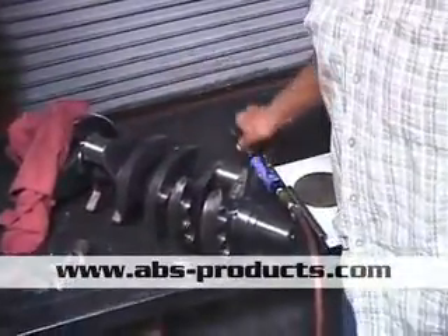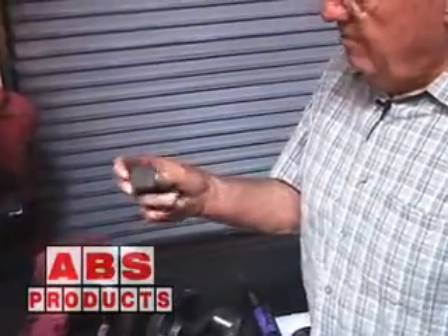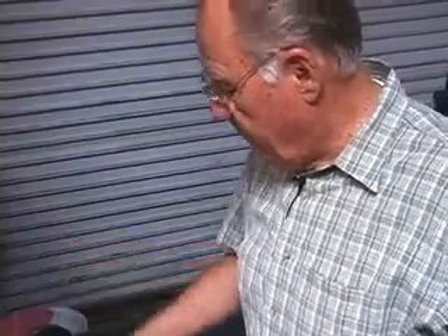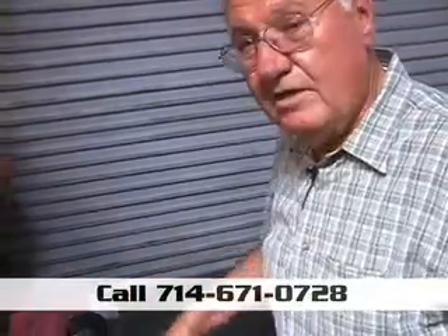If you're interested in those grinders, give us a holler — they're $59.00 and we're the only ones that keep the inch and three-eighths in stock. For all the LS1 stuff with that skinny counterweight, that's the 750. With one of these holes you pick up 150 grams, 300 with this — that's equal to about four holes of one inch. So don't forget you need to buy your heavy metal from us. We know what we're doing. Thank you.